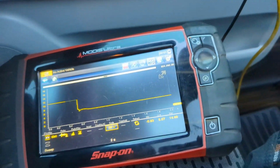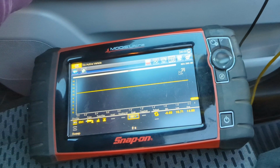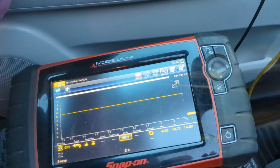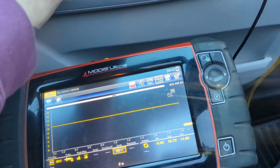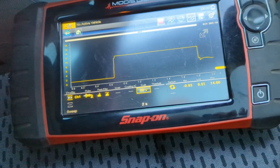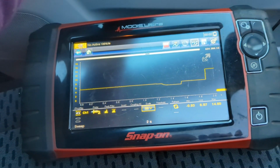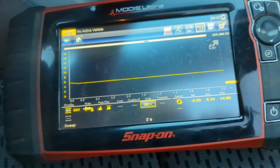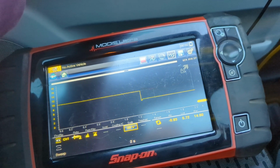Yeah, so these different voltage readings correspond to different signals. That signal's being sent to the door module. So the one touch, do I say one touch? If I just, yeah, sort of manual down, 0.9 of a volt, up 5 volts, and then the one touch function drops to 4.38, I think. So obviously we weren't getting any of that on this driver's rear switch, so yeah, I'm probably happy to say that the switch is at fault.